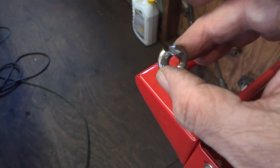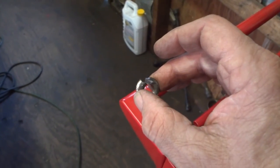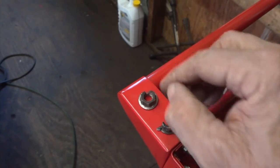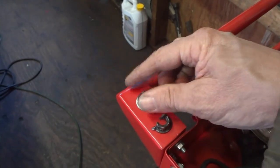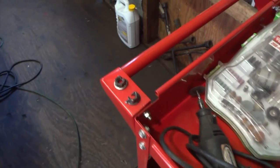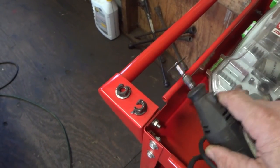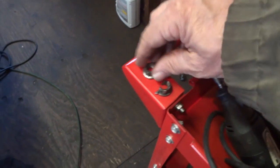After I worked on it for a few minutes, my bigger wheel that I had an air compressor on — well, I didn't have enough air pressure to run that. So I basically stuck with the Dremel. I gave up and thought I'd take my tool and see if I could zip this off. I zipped this off pretty easily. The other one on the manifold that's sticking down is at an angle, so it's really hard to get a socket on there. That's the one we're working on right now, and I'll show you how I got that off — I stuck the cutting wheel up in there, sliced the side of the nut off, and eventually got it off.